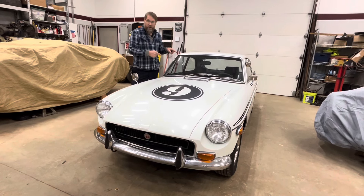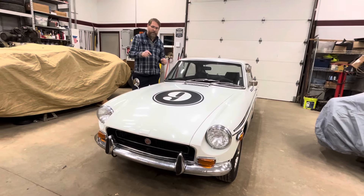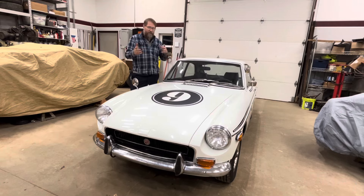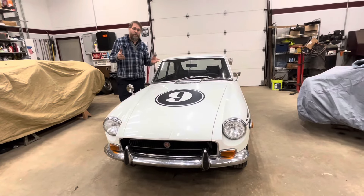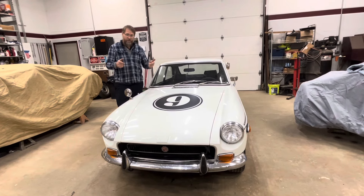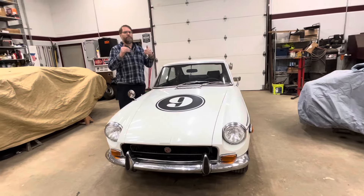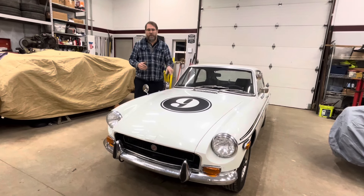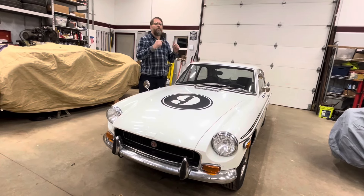After taking a look at the exhaust and discussing our options, I asked him if he wanted me to look at why it was running rough in addition to the exhaust system. After a bit of back and forth he agreed. I suggested starting with a compression test — if I was going to be tuning it anyway, we could do it right then while he was there, so we'd know if there's an engine problem like a burnt valve, and then decide what to do with it.